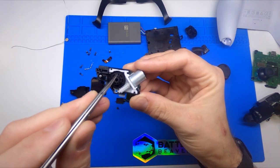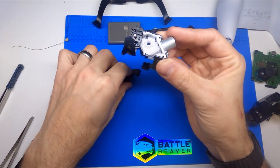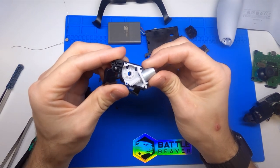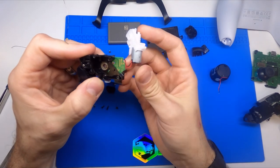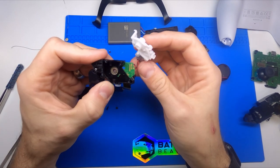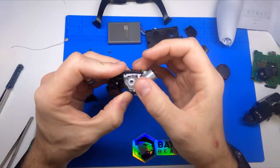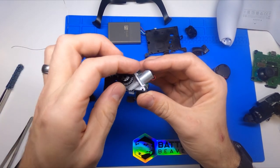This gear has half of the teeth locked out to prevent it from overextending in either direction. You can actually pull this whole gear out as well — and there's no lubrication in here, so this is just plastic on plastic. I kind of expected to see some white gear lubricant. You can even pull this entire housing out. If you're removing this, you could just snip these wires, take this whole portion, throw it off to the side, put the casing back on, put it back in the controller, and you would save quite a few grams.